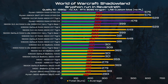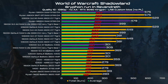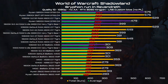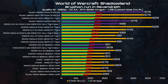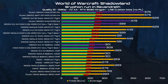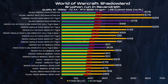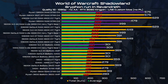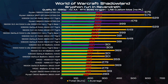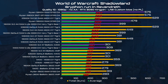In purple is what I can recommend if you're looking to buy components or refresh your PC. From the top, we have the Ryzen 5800X — the actual top performer, especially paired with the Viper Steel 4400 — followed by the 5600X. The good part of going AMD is that you don't need to touch the CPU overclock; the default boost algorithm is unbeatable and you just need to tune the memory. Then we have the 11600K, best if overclocked and paired with a good B-Die kit tuned to Gear 1 with tight timings. For a lower budget, the 10600K is still a very good deal, especially overclocked, and the F version is even a bit cheaper. The 11400 can also be a nice option if you don't care about overclocking.